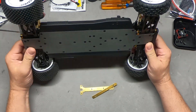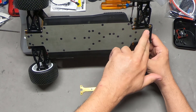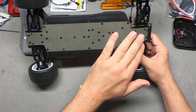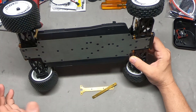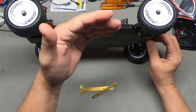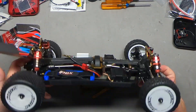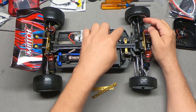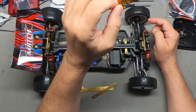With either kit, the chassis is completely flat — it's carbon fiber, they can't put a bend into it to get that kick. The kick is extremely important because it is part of our front-end geometry; it's part of the calculation of caster. We get some of that from our suspension components, but not all of it.